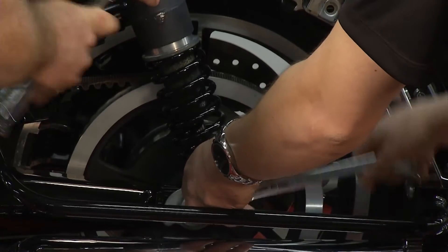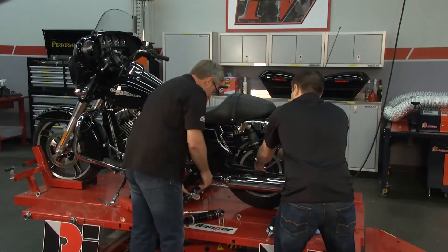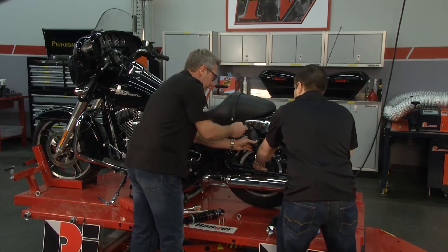All you do is pull off to the side of the road, reach down, grab your adjuster. You can go up to the plus — that's going to make it stiffer. You can go down to the minus and that's going to make it softer, and you'll have about 40 different clicks of adjustment.